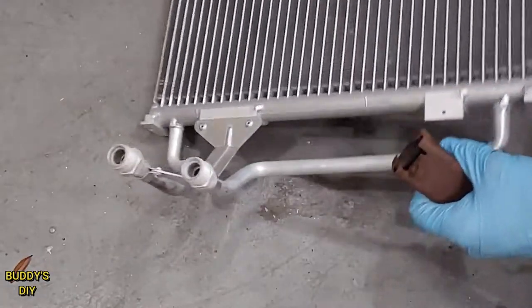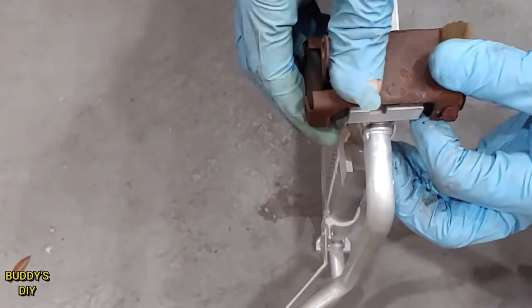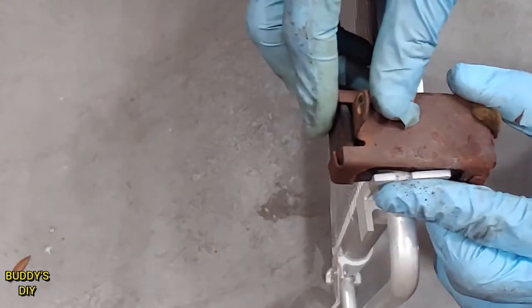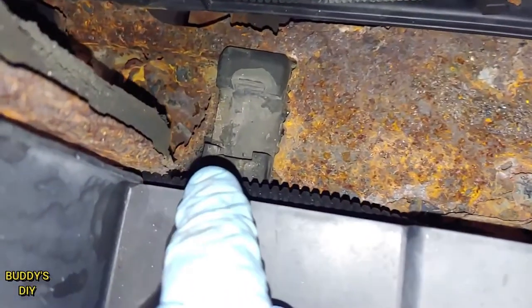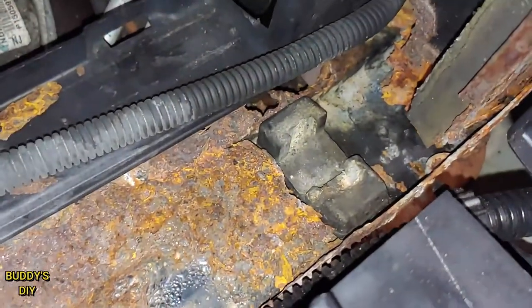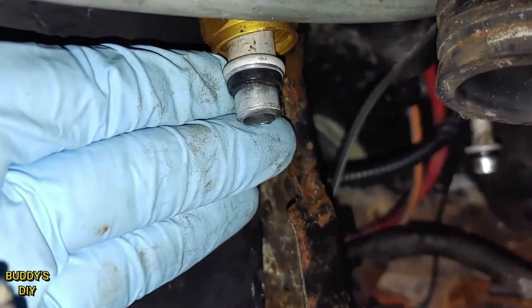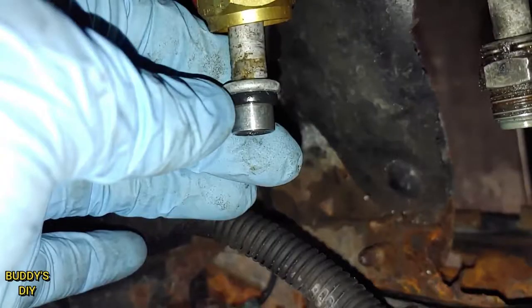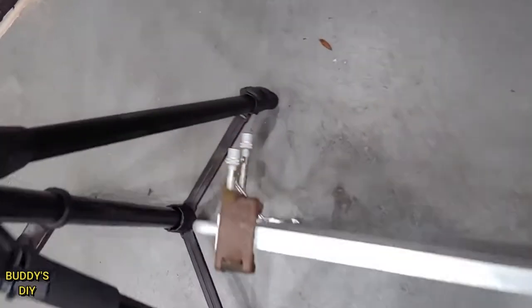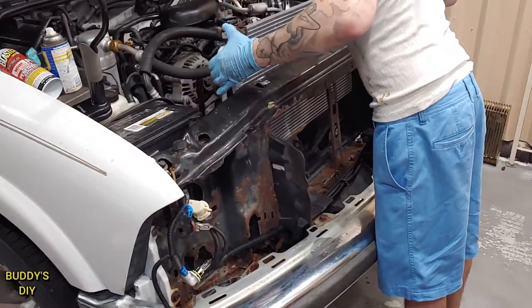With your bracket, make sure it is tucked in right here in this corner. Pull this apart a little bit and slide it right there in that corner — this part is where you secure it to the vehicle to keep it nice and stable. Also, there is a little piece of rubber that the condenser slides into right here in this gap. Make sure they don't fall out because they can fall out when you pull the condenser. Be sure they're in there before you install the new one. Also check your gaskets on your low pressure line and high pressure line to make sure everything looks good — no cracks, no rips, no tears. Now we are ready to go. Take the condenser and put it in the vehicle.